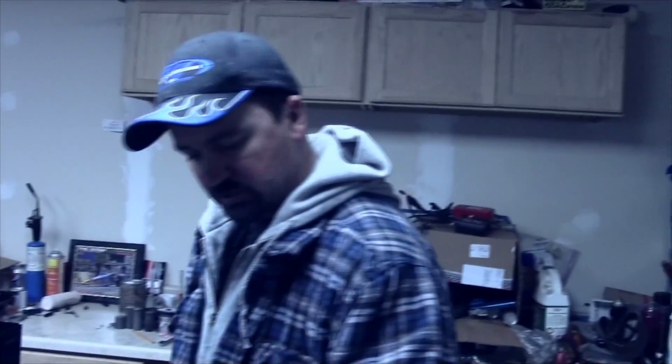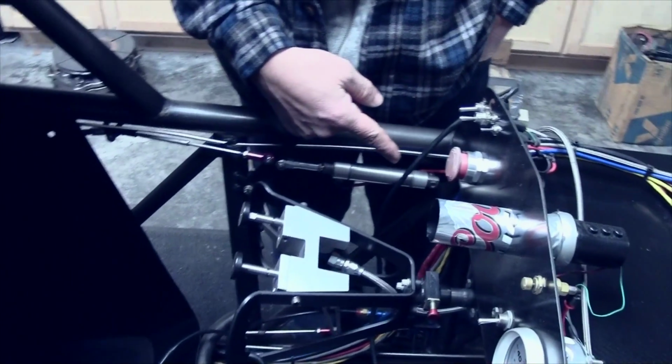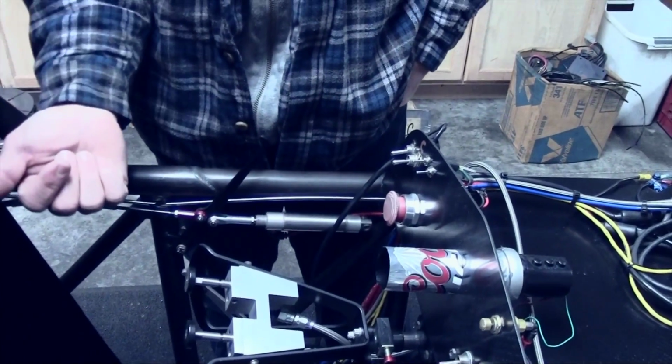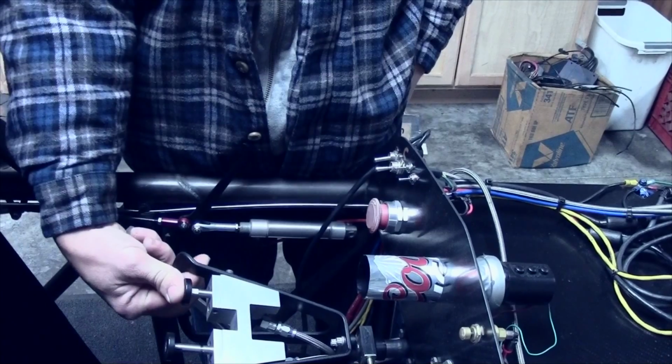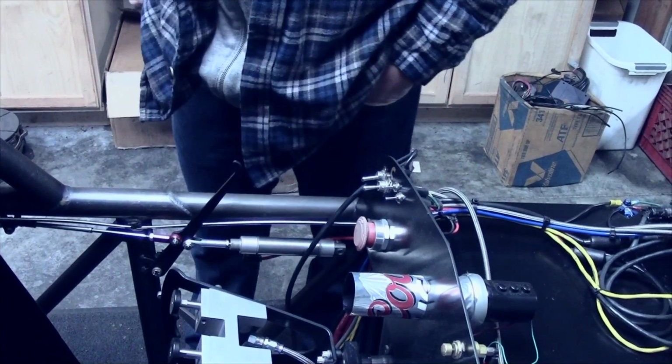Yeah, other than a tach, which I hardly ever use. Just a stage. I'll leave between 6,000 and 7,000 RPM, leaving the starting line, and then shift at about 10,000 RPM, maybe a little bit higher. That's awesome. It's got a 3-speed transmission in it. You use the clutch for staging, and when you let the clutch out and hit the throttle, then it shifts. You don't have to use the clutch to shift. You just push the buttons in. So it's a clutchless transmission.